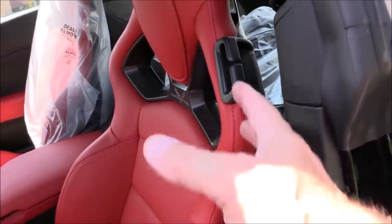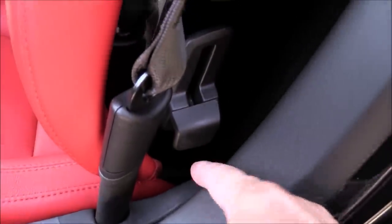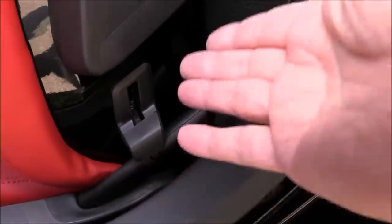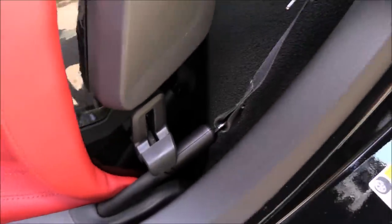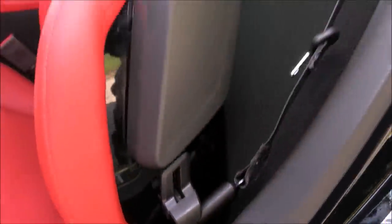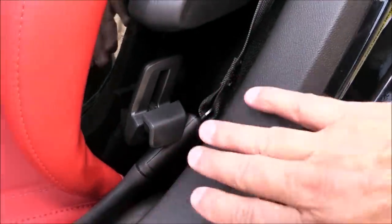There's one more thing to talk about with the memory package. What if you get in the car, start it, and your memory doesn't move at all? This can happen whether you have a stick or automatic. All C7 Corvettes have a power recline, but if you want to manually pull the seat forward to grab your jacket or bag, there's a lever for that. What prevents your memory package from working — regardless of transmission — is that as you pull the seat forward, sometimes the seatbelt falls back and gets trapped underneath that lever. You pull the seat backwards, it's still underneath there. If that lever is tilted up just a little bit, the memory package won't work at all.